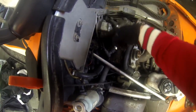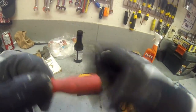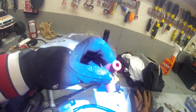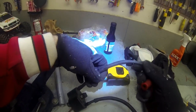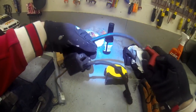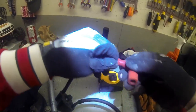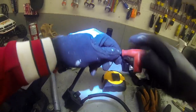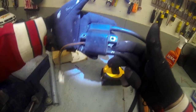Maybe it was the boot or even the wire, so that was the next thing to check. I have one that's already out — these boots, what you do is just unscrew them and they pop out. There's a screw attachment inside that screws into the wire. Some of these screw off, some are sealed units and don't come apart. This is your next area to check — it's one of the cheaper pieces.